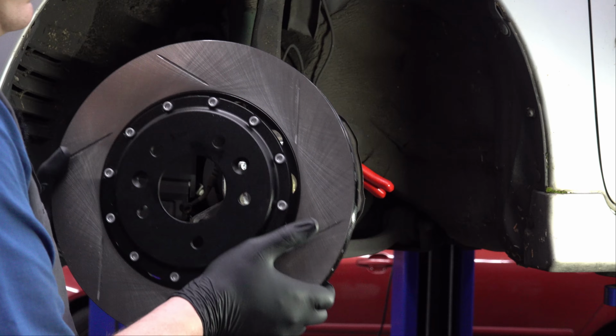And what it does is it pushes this pad against the brake rotor, and then equal and opposite reaction means that when it pushes out that way and hits something that stops it, it starts pushing back on this side that way. So it squeezes the pads together that way. But it all sort of relies on no friction and this and that and the other. And needless to say, this is not the best way to do brakes. It ends up with uneven wear, uneven braking force.